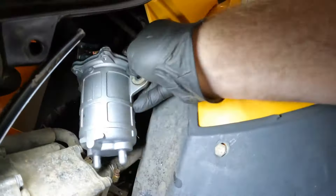Let me get some light in here so you can see it. We're trying to get to that 10 millimeter bolt, but we're not going to start with the bolt first — we're going to go ahead and pull these hoses off. This bike does have a petcock on it but it doesn't have a knob on it like some of them do, so we're going to turn it to off to keep the fuel line from flooding us. This is the fuel line from the petcock from the tank, so it's going to have a little bit of gas in it.